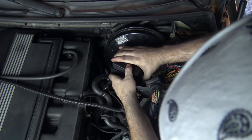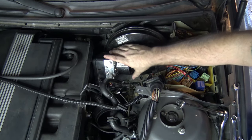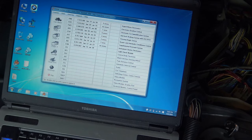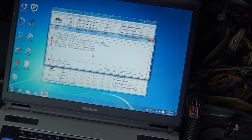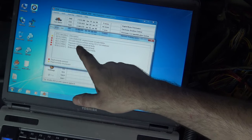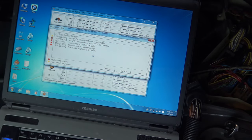This is really the only replacement module I have. Already got the ABS module scanned. It shows: DME/DDE engine torque not adjustable, chassis number wrong, ECU not initialized — that's because I haven't programmed it yet. Pressure sensor one and two faulty, and brake fluid level. Okay, so there's no internal fault. We know the pressure sensors are unplugged and the brake fluid level sensor is unplugged — that's what's causing those. As long as there's no internal fault, I guess I'm happy.